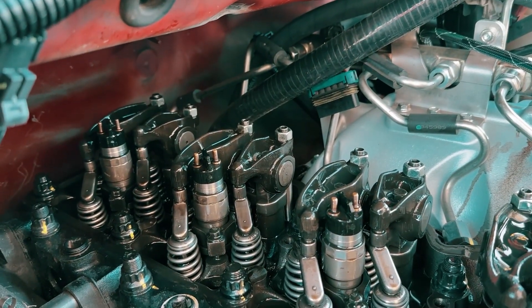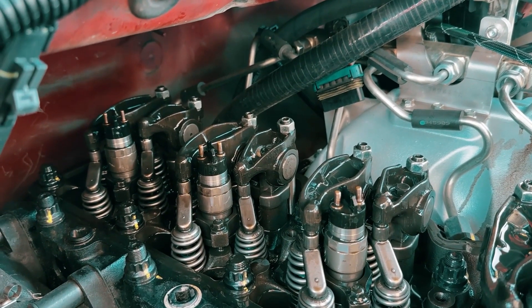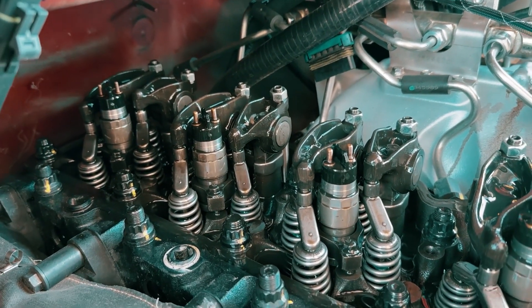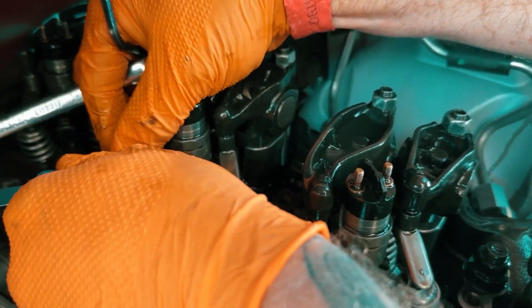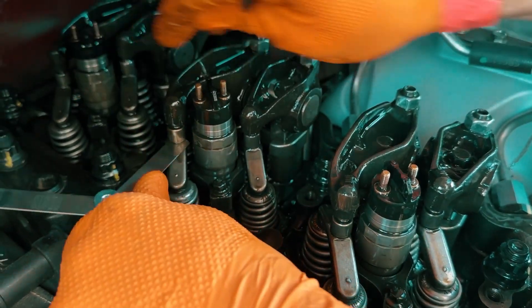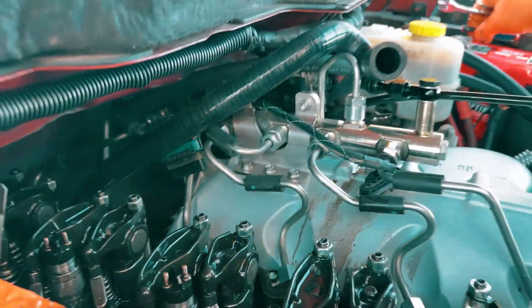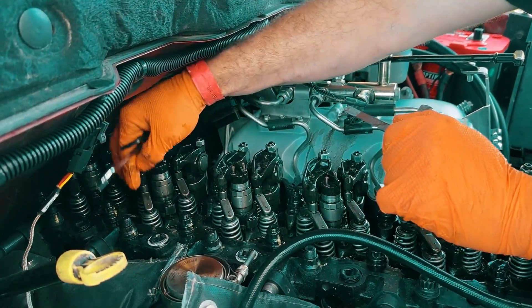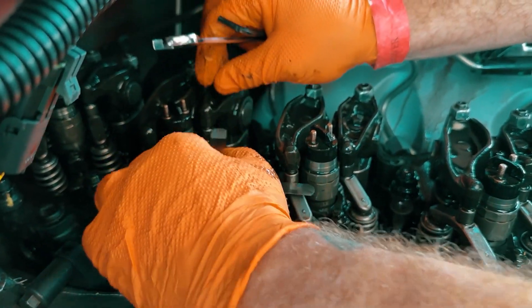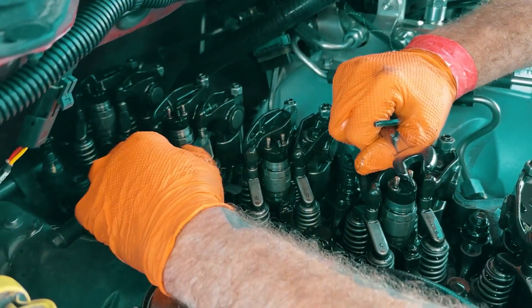You just move to number five. Get five intake all the way down, just like that. Go back to your 20 thousandths feeler gauge and check underneath that valve — she's tight. Now switch back, bump it around just like you did on number six. Number five exhaust down. 10 thousandths feeler gauge under the spring bucket. There you go — that one's good and tight.